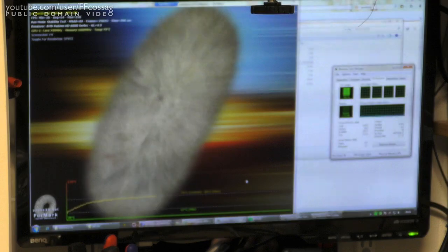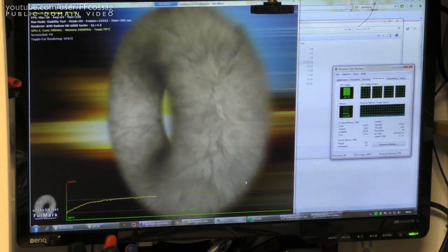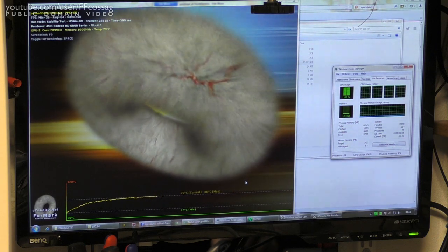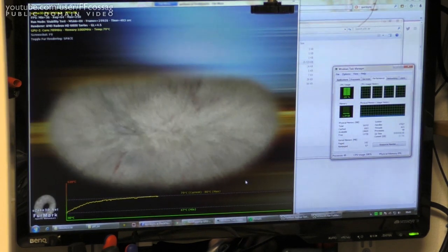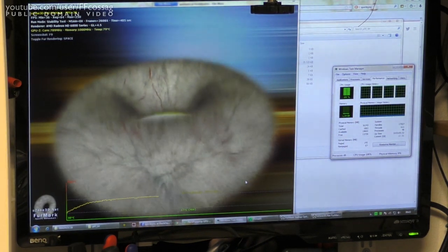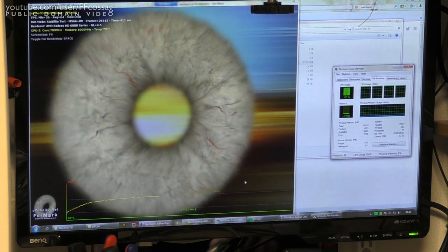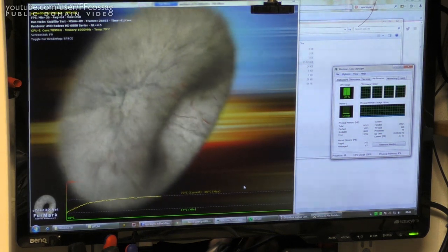Mostly I want to get rid of it because it simply pushes the idle power consumption of the machine way up. It's drawing over 60 watts just sitting, and the GPU is pretty much the only thing running warm while it's doing that. So the GPU is going to come out, we're going to lose some idle power consumption, we're going to gain a lot of space in the case, and it's no longer going to be making awful noises on load. And there we go.